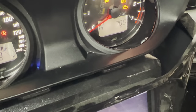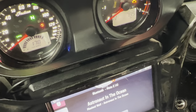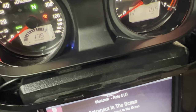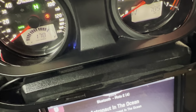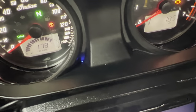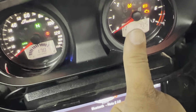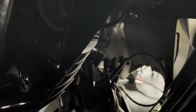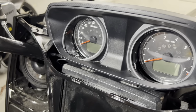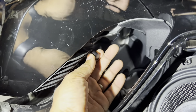We're going to play the track and slowly bring the bass knob up. Now the woofer's clipping. We're going to back it down a little bit — you'll notice it's going to stop blinking. It looks completely stock; you can't even tell we touched it. The knob is nice and hidden but easily accessible.